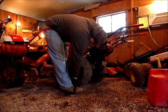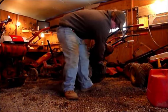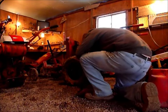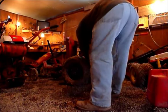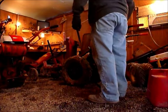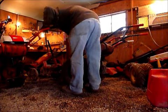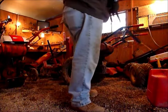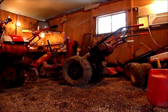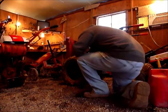We'll try just a touch of choke. Let's try. Whew. Can't believe it hasn't started yet. Alright, it's really starting to agitate me now. What in the world is going on? Kill switch is off. It's not grounded. Huh. Maybe it's just too cold out.